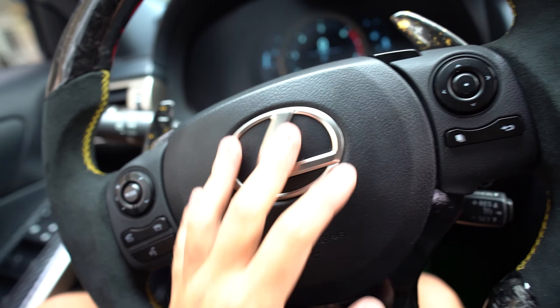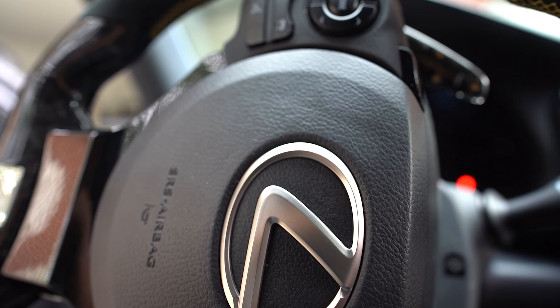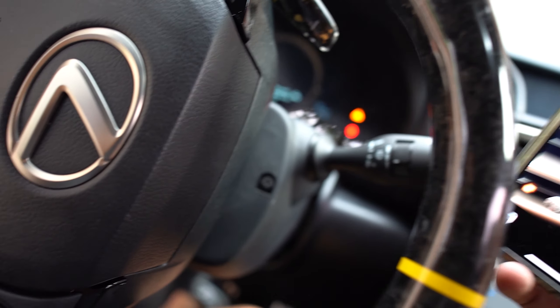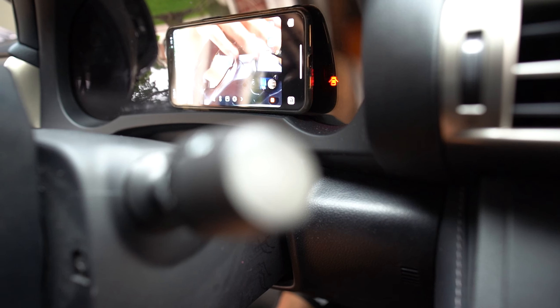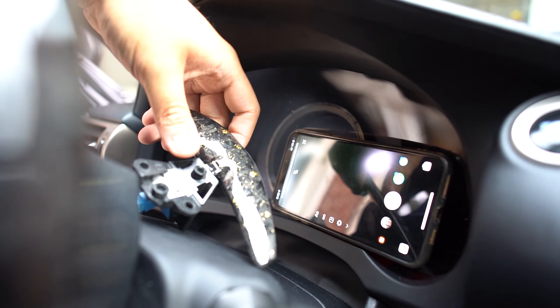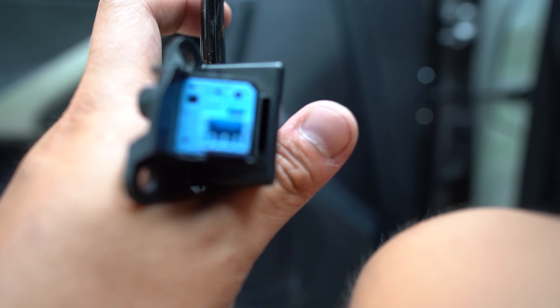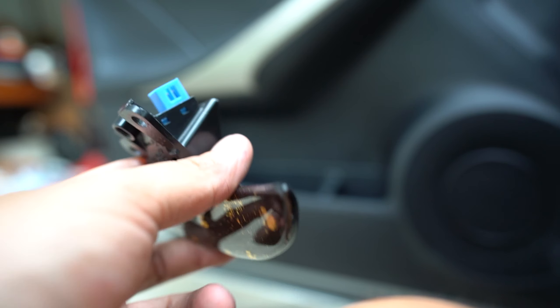Back home. To fix the paddles without taking off the steering wheel all the way, turn it clockwise so the paddle you want is on top. You can't really see behind the steering wheel, so I'm using my phone's Instagram screen as a mirror. Now you can see the screws back there — undo those and the paddle should pop up. Using the phone-as-mirror method, the paddle is out and you disconnect it by pushing this pin. The problem is actually inside the module, which is held by four clips — two on top, two on the bottom.